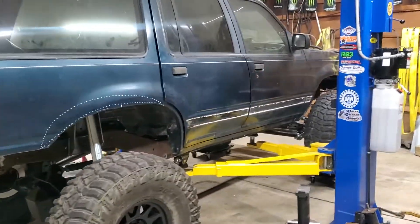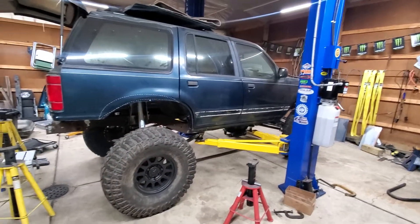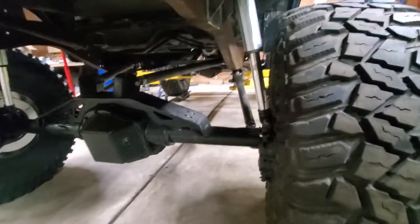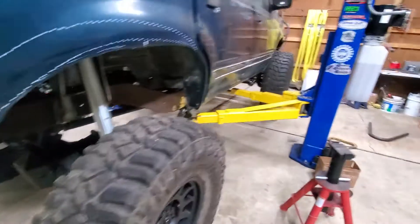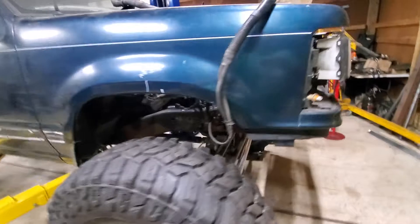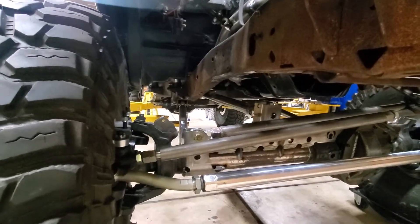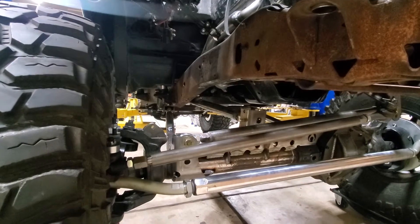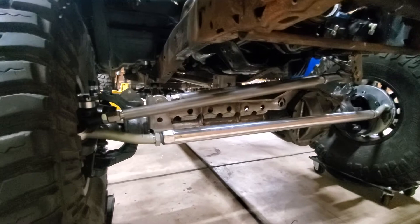As you can see, still being supported by the hoist. The rear is pretty much good to go. I didn't move the axle shock tab mounts in yet, but my focus has been on the front three-link, which is now pretty much done. All the link mounts are welded and set up. I still have to trim the upper truss link mount bracket down a little bit.